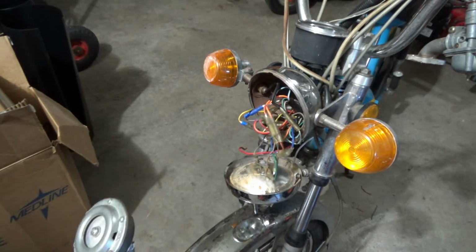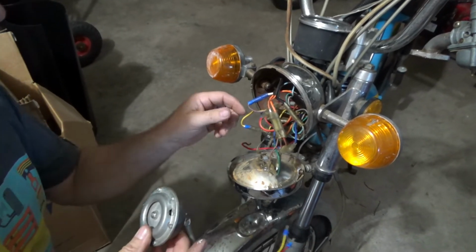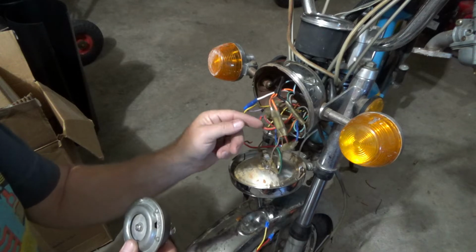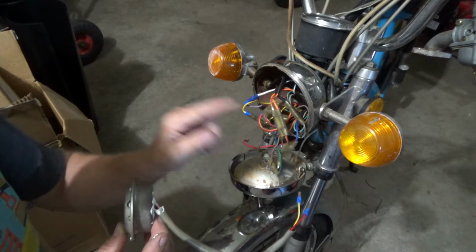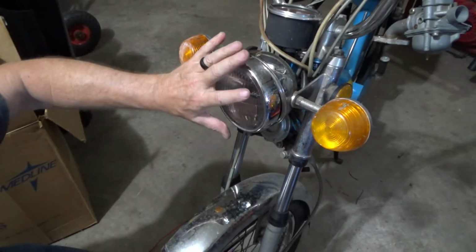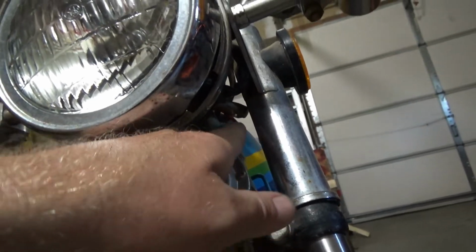Opened this headlight back up. And in the previous video we didn't have a purple wire, so I ran a brown and white wire back so I could find it again. I was planning on using these wires but I'm not going to, and then this red one here with an orange stripe. So I am going to fish this wire back up, plug these in, screw this where it belongs, and we should be fixed up. Let me put it down here. It just screws right in. Right there, and then just run up and in.